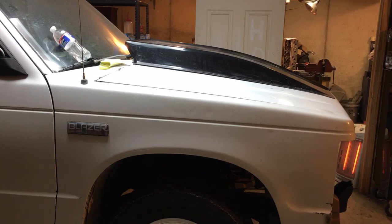So I was very motivated to find a deal and go pick it up so I could get a hood that would fit on this thing and keep the weather out. I appreciate you guys watching. I'm really excited about my hood scoop score. I'm a little bit embarrassed because it looked to me like it was going to need a 4-inch cowl hood - but always give yourself a little extra space. It's not too big of a cowl, so when you're sitting in the driver and passenger seat it doesn't obscure your vision. Andy's green race S10 has a 6-inch liftoff Harwood cowl hood - it's hard to see around. Anything over 4 inches of hood scoop, you've got some blind spots in the front and you need to be very leery when driving.